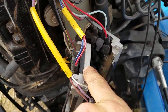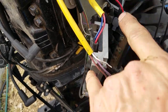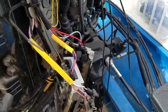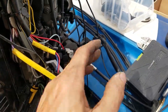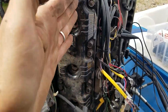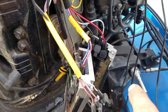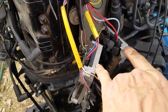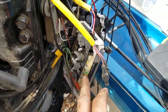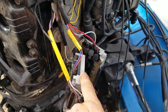These packs don't know each other apart — they're twins, so you can switch them around without changing the wiring. One pack is going to fire one side of the cylinders, and the other pack fires the other half. So if you have no spark on one side and spark on the other, you can literally flip these around — just don't change the wiring. And if everything's moved to a different bank, then one of the packs is faulty.